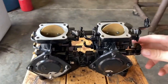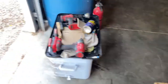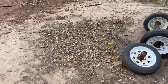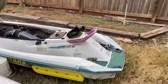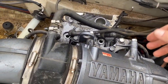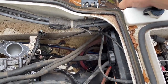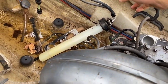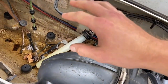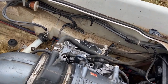We finally got the carbs knocked out and cleaned — I know it's been a while but finally did it, and I think they will be good to go. Now if we walk over here, I'll show you guys what we need to do to get ready to stick those carbs on. As you can see, no carbs obviously. We're gonna rip out all this old fuel line and bypass the reserve to have fewer failure points in the ski. We'll probably keep the fuel filter, but we gotta rip out all that first, clean up the gasket surface, and then we'll be ready to stick the carbs on.